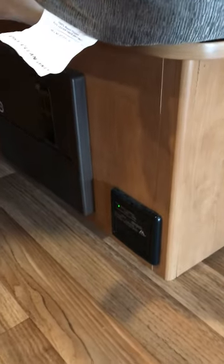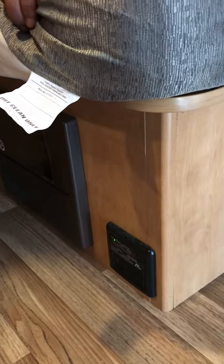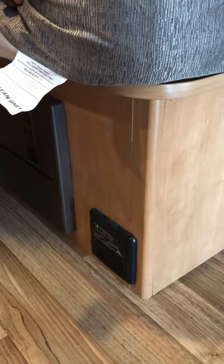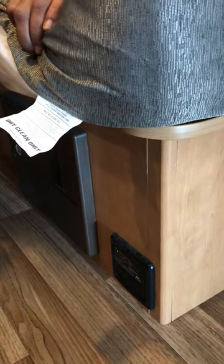Did you go over what's in the front of the bed underneath there? All right, this is going to be your carbon monoxide and LP detector. Sometimes it goes off. Hairspray will set it off, and dust will set it off. If the alarm goes off, how do you shut it off? You really won't be able to shut it off, because it's going to go off until it's done detecting. The best way of doing it is keeping a can of compressed air, like used for a computer keyboard, and spraying that on the sensor, and that'll clear it out.